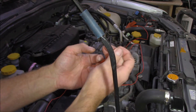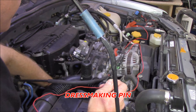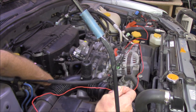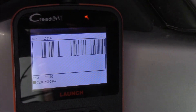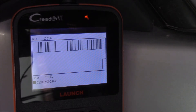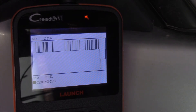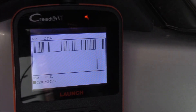My positive lead off the battery — touch that — and also reach down and touch the wire on my sensor that I've just connected to. Let's have a look at the scan tool and see what it shows. We're now touching that wire. Did you notice it responds straight away? I'll just hold it there for a little while and then we can release it. Keep in mind the C Reader is a little bit slow, but you can see it's changed already simply by using my body as a resistor.